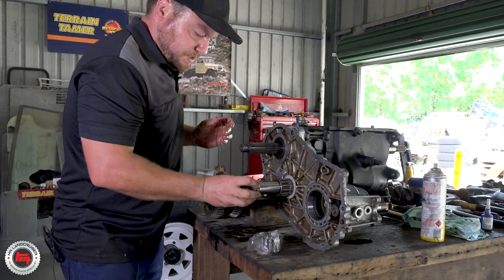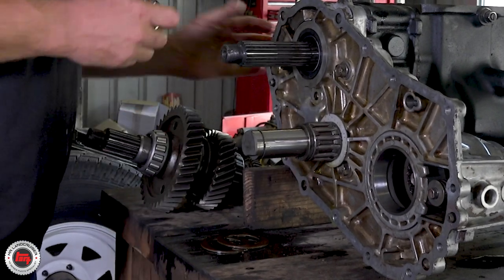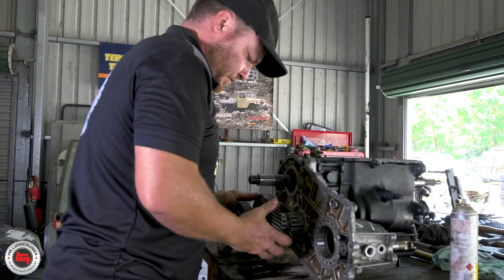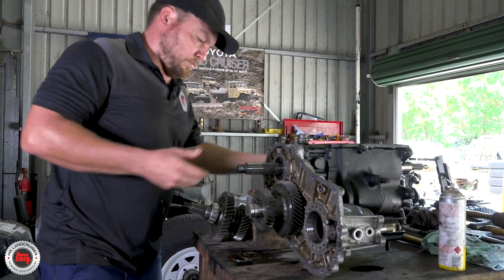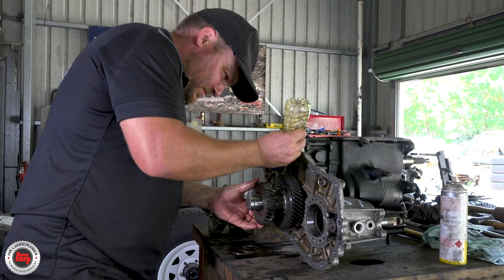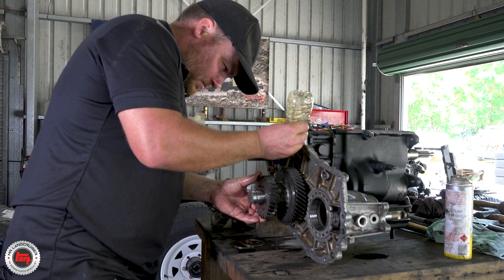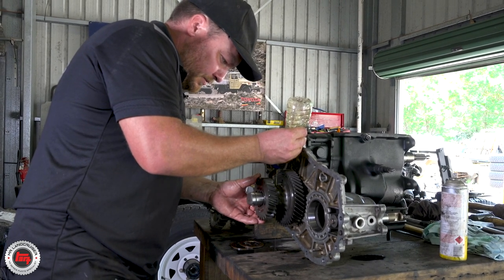Make sure you remember the spacer between the two bearings. We're putting in a spacer that spaces out the two transfer gears to make sure the bearings are right in the centre of them. This is the idler gear which transfers the output shaft drive down to the actual forward and rear drive shafts through the transfer case. It's got two different sized helical gears on it because you select one or the other for low or high range. This will just feed up that bearing so when we get first motion we know we're lubricating.